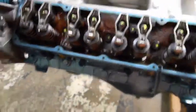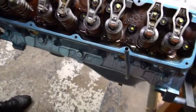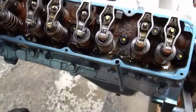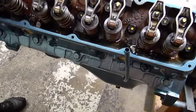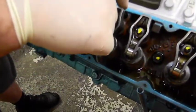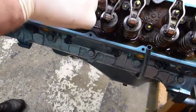You want to go over there and look? We've got to get my pan around here for sure. So here's how fast I get oil pressure. It's like this third rocker in — I don't see nothing. There's still a couple that don't have anything. That's just the way they're sitting on the board. If you notice, this lifter is slightly down, so this probably isn't lined up — it's not filling up. And my drill is ready to go on fire. So every other one's pumping minus this one and this one. What has to happen is you crank the engine and get these to seat down and they'll fill right up.